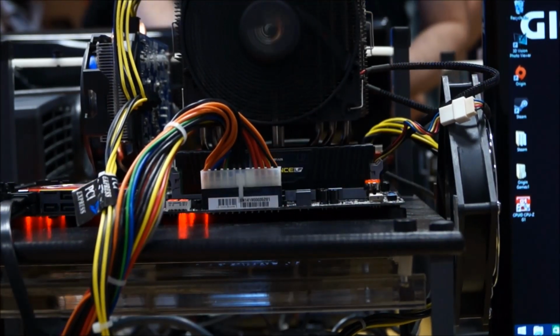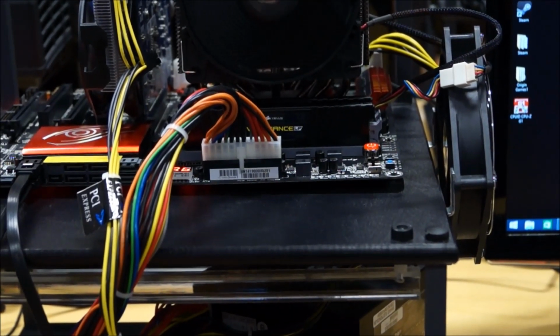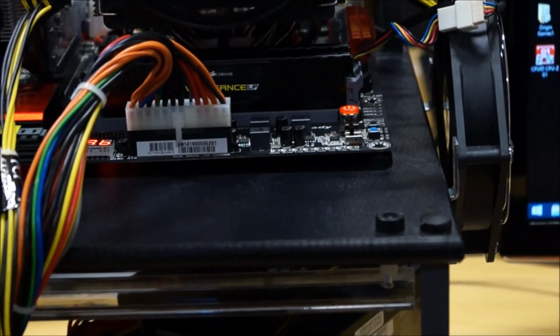and you can swap between the dual BIOSes. And what that basically means is when you're overclocking, obviously it's one of those things that what you need to do is adjust voltages, change the frequencies and things along those lines. Every single CPU will overclock slightly differently, no matter whether it's a standard i7 K series. All of them will perform slightly differently depending on the grade of silicon that's actually in there.